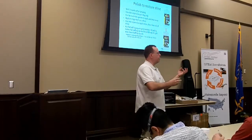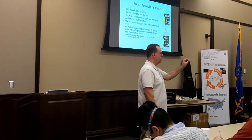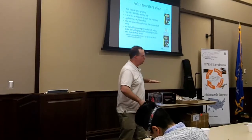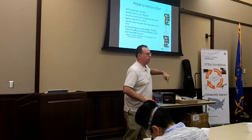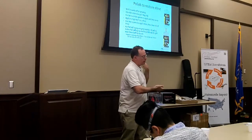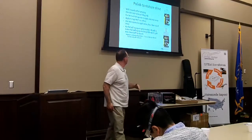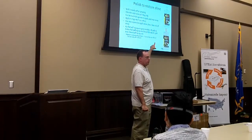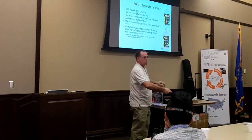Make sure there's no grit, dust, or anything in your rags, because you're rubbing hard enough to generate heat, and any grit will scratch and leave a mark. I'm always shaking the rags out and knocking them against my hand to make sure there are no foreign objects. A lot of times you can stop after Meguiar's number 2 if it's a good paint and wet sanding job. The number 9 just takes it up to the point where you can read print off labels — a mirror finish.